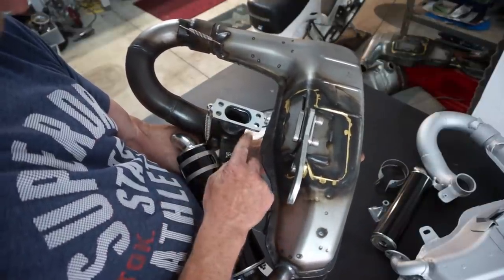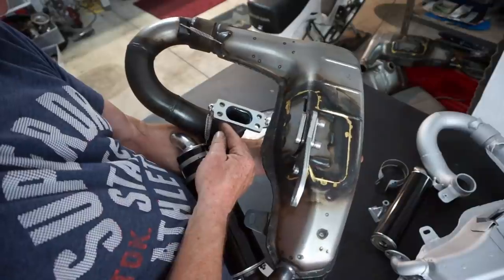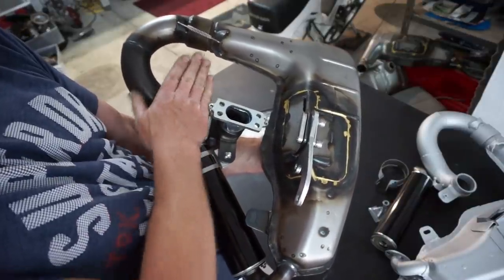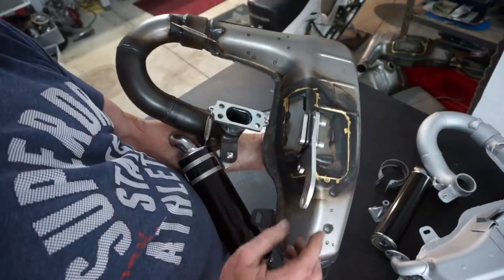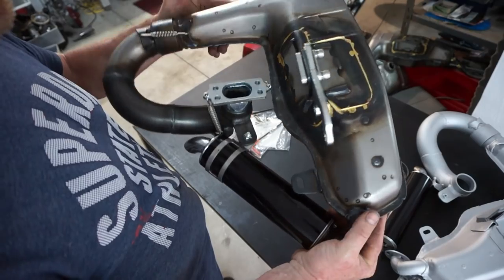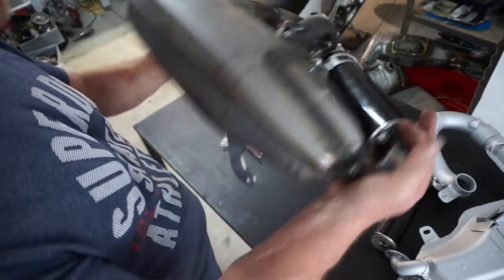They need to be in behind, or one here on the front and one here on the back, on a separate little clip. Out that far, you can't get your cowling on, because it falls on the spring, so you have to cut the cowling away, and that reduces cooling. So this is going to go onto a bike and we're going to test it — the painted version is the one we're going to test.